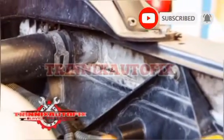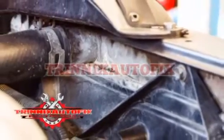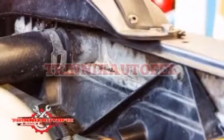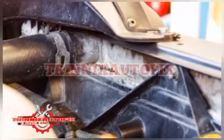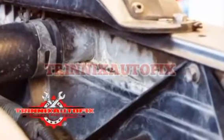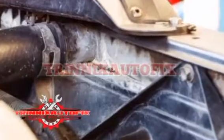The most common reason that coolant leaks from the hose is because of damage. The hose becomes cracked or broken. Otherwise, coolant can leak because the clamp torque isn't sufficient or the clamp is defective. Many problems with the hoses start out because the system overheats. Let's dive into these issues more fully.